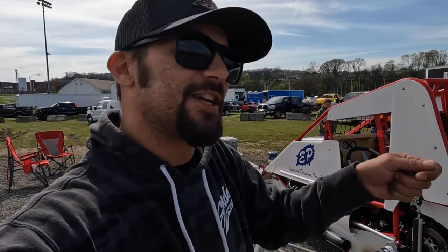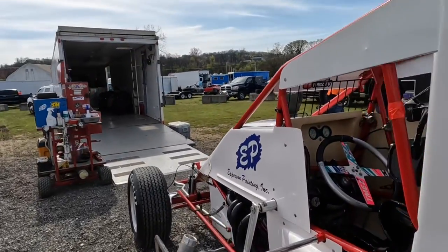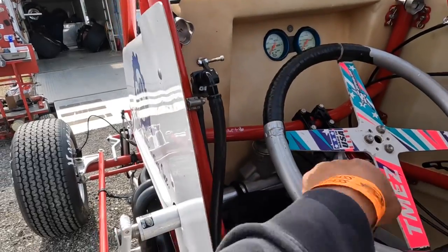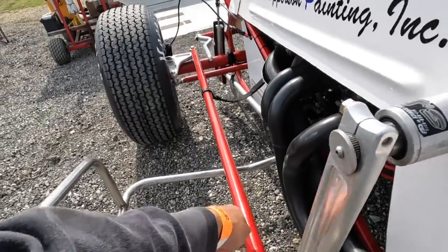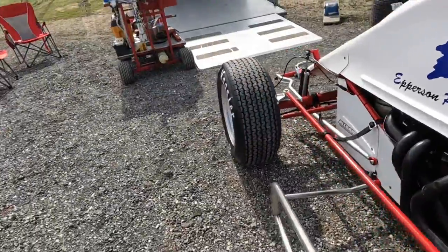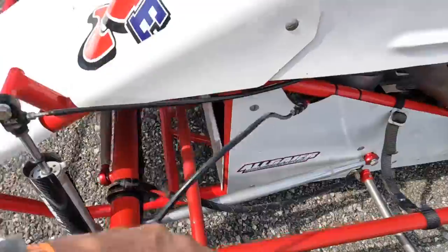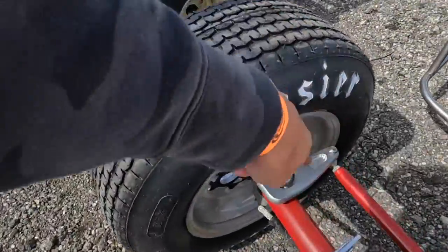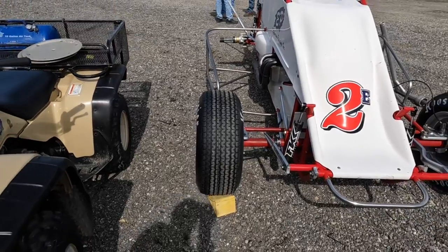And then you got that big steering wheel. Remember that old truck just kind of wandered around and you kind of had to roll it and just chase it all the time? Same thing here. These things have so much slop in the steering because between the gear going there to here, all these heims have play. And then just to get to the right front to steer it, it all has to go through all of that to transfer over, so this thing tends to be not as nice and straight as your street car.